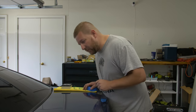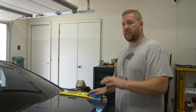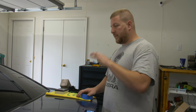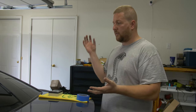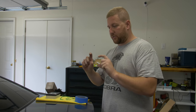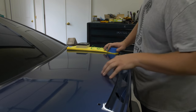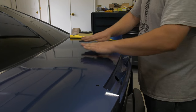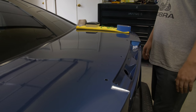From the last time we painted it a few weeks ago, it was super glossy in the booth, super smooth. But like we explained in that video, this paint over time likes to shrink. As the solvents come out of the clear, that clear shrinks and shrinks, but it left us with a pretty orange peel-y surface. It's designed to be wet sanded smooth and then buffed to a mirror shine.